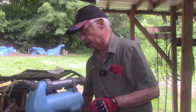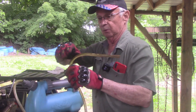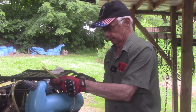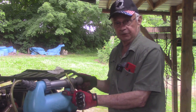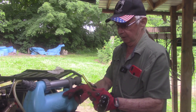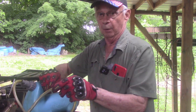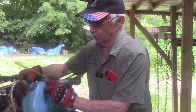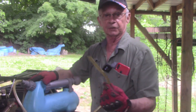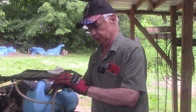But I got this nifty little thing right here — it helps a lot. I've had this 20 years at least, maybe more. I don't remember where I got it. You loosen this handle here and pump it three, four, five times and it creates a vacuum. Then you stick this hose down in the oil tank or whatever you want to empty, open this valve here, and it sucks it all right out.